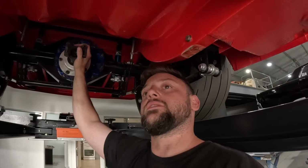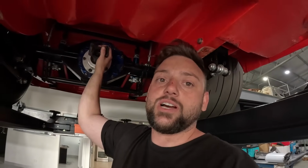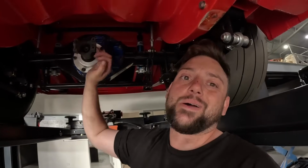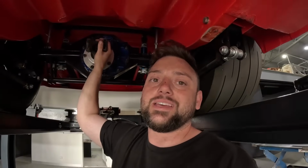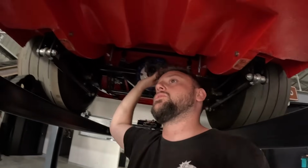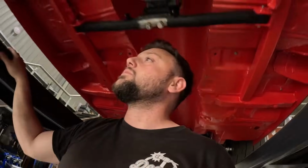We're going to jump into whipping this pinion off because Lockie's on his way back with a tail shaft and the new yoke. Like Matty said, because this is a solid bush, we'll be able to zap it off and zap it back on because we're not going to have the crush tube or anything in there like some do have. So we'll whip this off, and I can actually hear the ute pulling up right now.